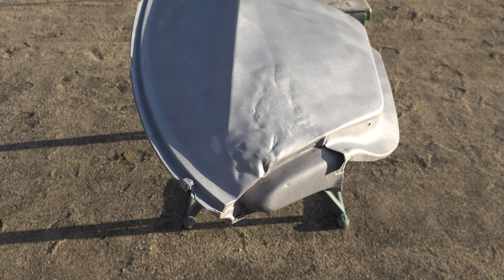Seeing the fender like this gives me a good idea of what needs to happen next, and it even allowed me to see some damage I had previously not seen with the fender just lying down. With this new information, I begin finalizing the bodywork up front with a slapping spoon. The slapping spoon allows your strikes to the metal to be more spread out, helping smooth things out. After finishing the front up, I begin working on the huge surprise dent in the back. There was a subframe behind this dent, so the hammer and dolly was not an option here.